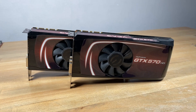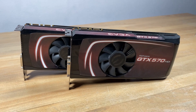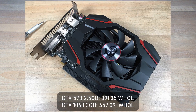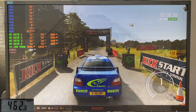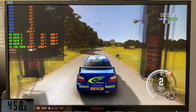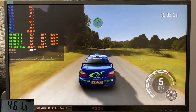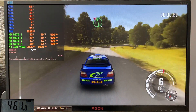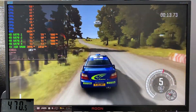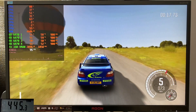To give some context to the benchmark numbers, I've also tested an SLI GTX 570 setup, each with 2.5 GB of VRAM, and a modern Pascal GTX 1060 3 GB. In the MSI Afterburner overlay on the left, you can see the utilization, temperature and clock speed of each of the GPUs. Under that, you can see the video memory — Afterburner puts the 4×1 GB of VRAM together, but effectively it's still 1 GB, so divide that number by 4. And on the bottom left, there's a live view of the total system power consumption.